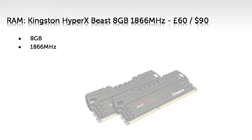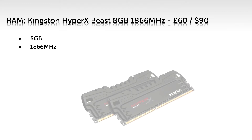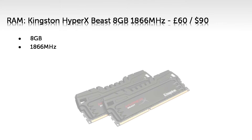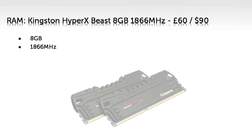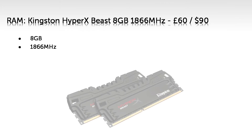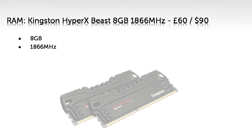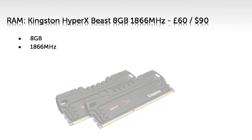For the RAM, I've decided on Kingston HyperX Beast 8GB 1866MHz, which you can pick up for £60 or $90. This awesome HyperX Beast series of RAM from Kingston is what I look to when I want really fast RAM — this is going to allow us to utilise some of the ridiculous potential of the motherboard. 8GB, as I said in the previous build video, is ready for next-gen games as they will be looking to utilise the 8GB of RAM in next-gen consoles. Also, 32-bit programs only use 4GB of RAM maximum, but having 8GB will allow you to take full advantage of newer 64-bit programs. 1866MHz is very fast RAM — by no means the fastest in the HyperX Beast range, but it will give you an edge.